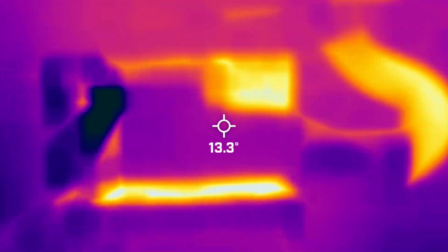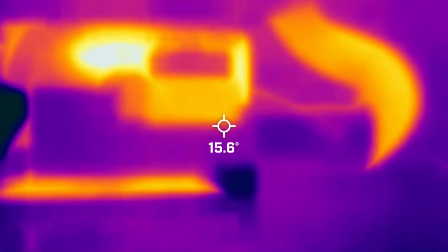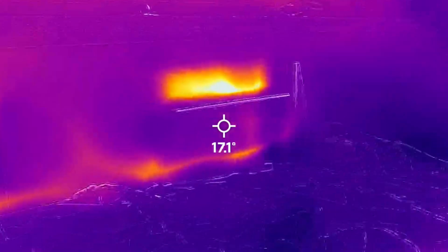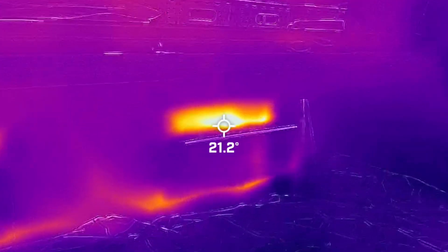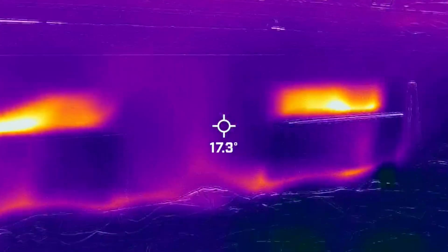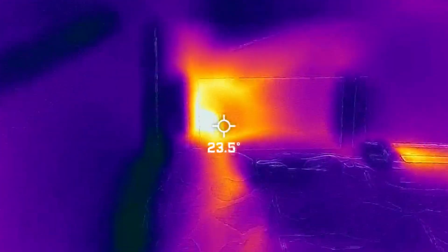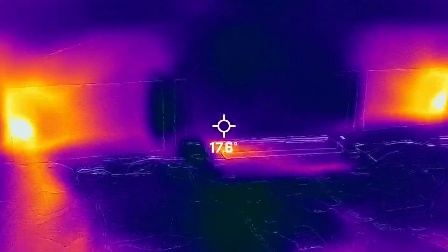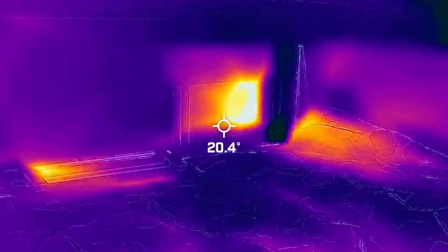What I've found is it's not always best with the current setup to have it in the hottest mode, because I think what happens is the pipes obviously retain the heat a little bit in terms of the way they flow into like a T position, and that kind of makes the internal heat sensor turn the heating element off, leaves the fan on, but I do think it impacts the heat flow a little bit as well. You can see in this overlay that I tried to show how the heat flows and where the heat flows with those grids on and with the grids off. You can see already here that the light is now turned off again.